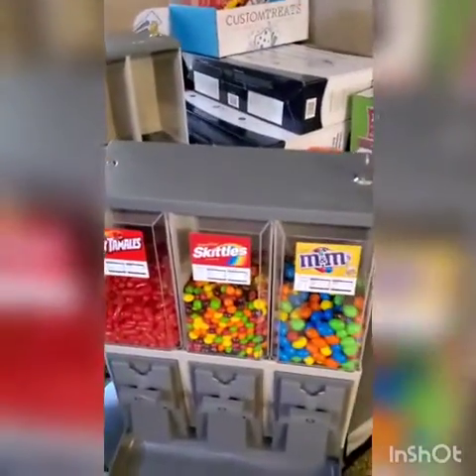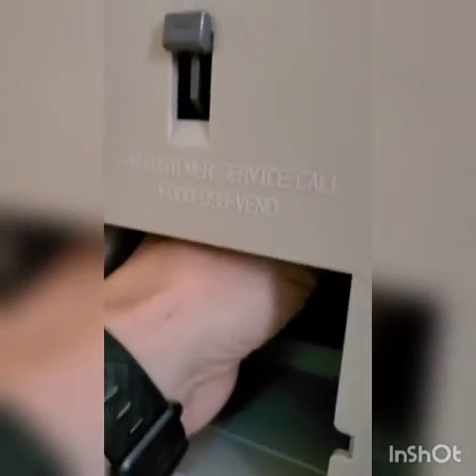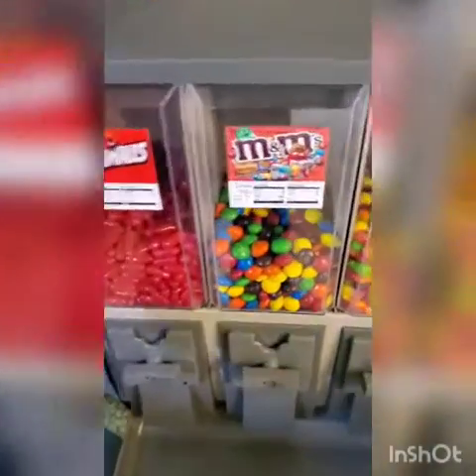We've got two more machines set up here and I'm ready to go. One of the keys is going to be the test to make sure we got the volumes right. We need to go in the back — this is where we get our quarters from. One of the tricks with this particular machine is that the quarters will oftentimes get stuck up in the dispenser. If you've got multiple quarters coming through it's okay, because they'll eventually fall out, but when you're checking the machine it's an important point. We'll grab our test quarter and go around to the front and test each one out.